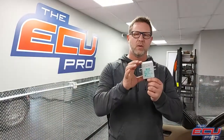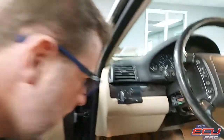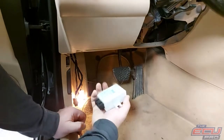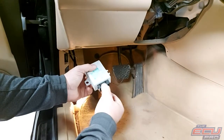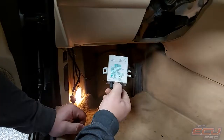It has an EWS module — it'll actually say EWS on it. It's a small white box. There's going to be a panel down here; we have ours removed for ease of use, but there's going to be a couple of screws — you pull the panel down. This will be mounted up on a 10 millimeter bolt up here. Remove the bolt, it will then slide sideways, and you unhook the connector. We need the EWS, the DME, and the key.